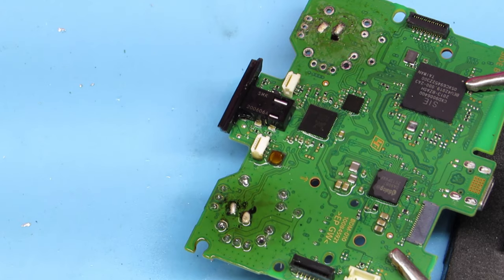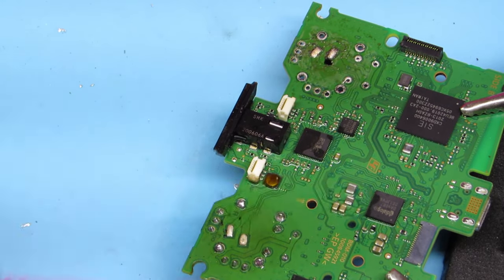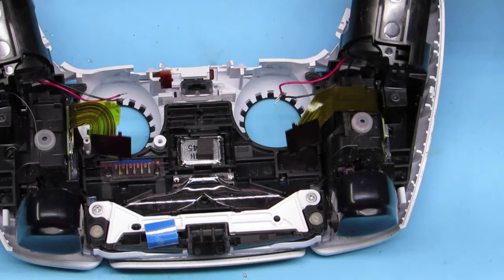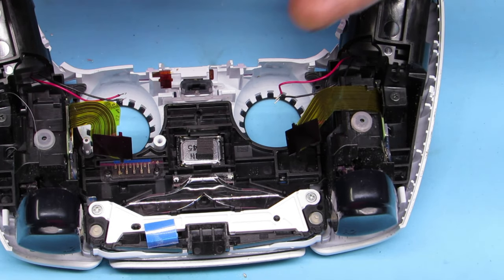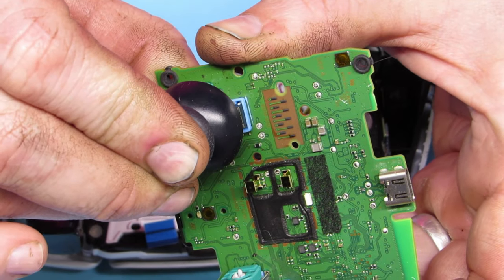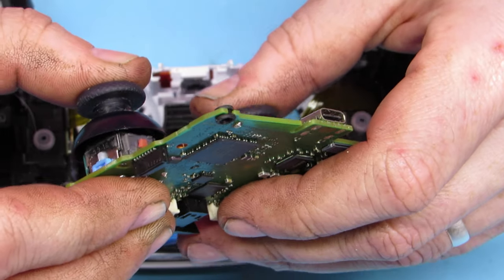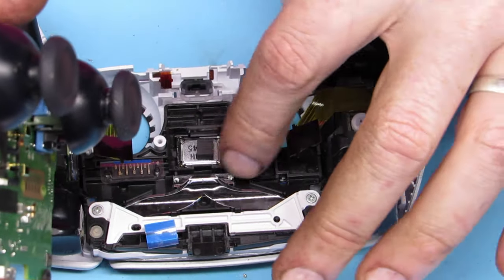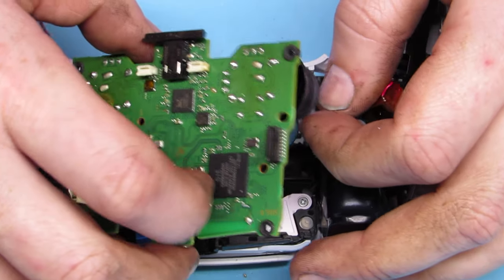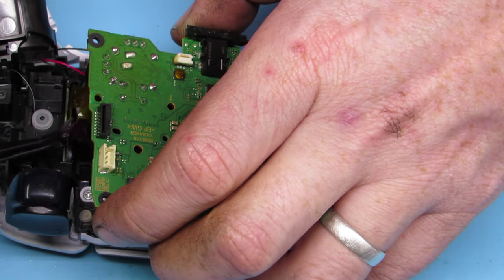I go ahead and get the board cleaned up a little bit, just to be nice and fancy. You can see there's a little bit of discoloration from the heat, but there's no damage to the board itself. Just take that toothbrush and clean it right off. We got both of them installed — same deal on the other side, exactly the same way. Pop your thumbstick caps back on — do not forget to do that. If you put your controller all the way back together and you don't have those thumbstick caps on there, you're taking your controller apart again, because they don't go on from the outside.